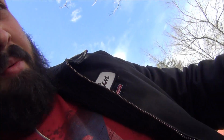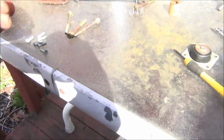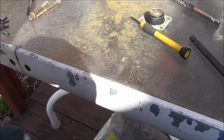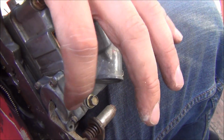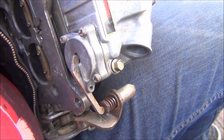Another thing, a lot of these 800s are double pumper carburetors with these center hung float bowls. Got these in them. Take these out. They're inside there. All they are is a restriction for fuel flow. They're filters, but they suck, so take them out. And if you're doing a conversion like this on 660, never forget the 50cc accelerator pump.